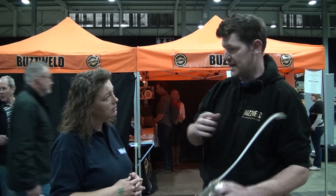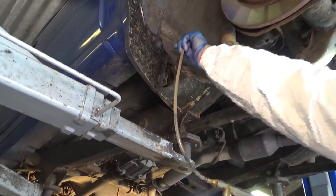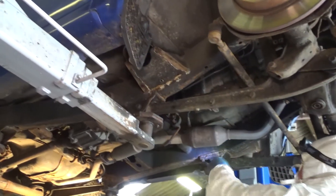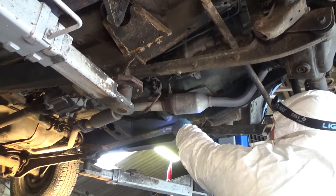They don't have the VCI. When you spray this inside the chassis, you're going to have bolts and things inside the chassis for outriggers and all this sort of stuff. When you put that in, chances are you're going to go one side of that bolt and not the other, so you're going to get a good spread underneath but not on top. If you want full coverage, you want a VCI.